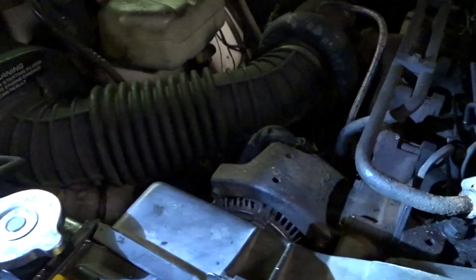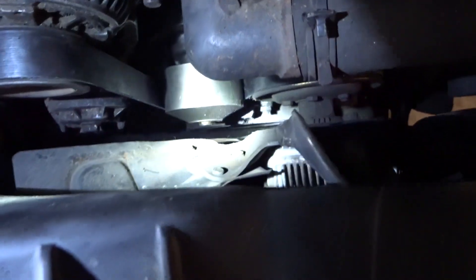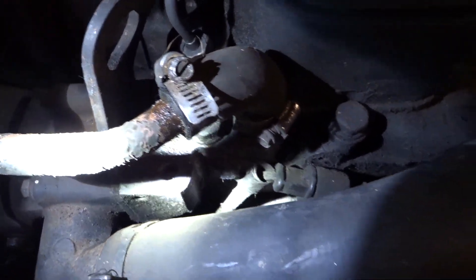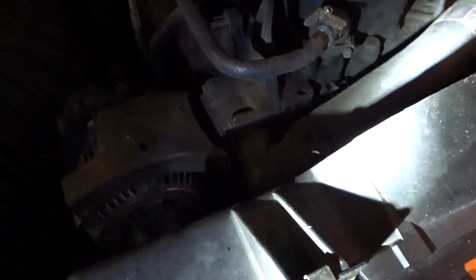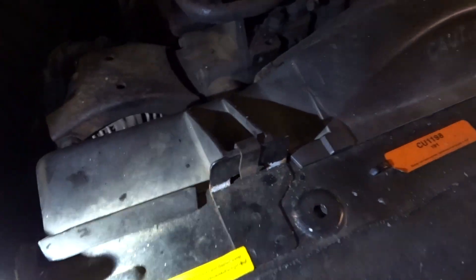I took the other light down. As you saw, I got the water pump on, got the new belt on, put the coolant back in, and bled the coolant from this very top heater hose line — kind of a vent line. Just kind of vented the air. I'm sure there's still some air left in it, but hopefully whenever the thermostat kicks open next time it works itself out.